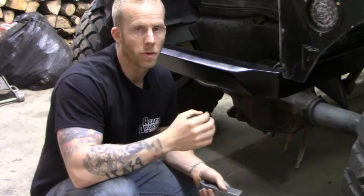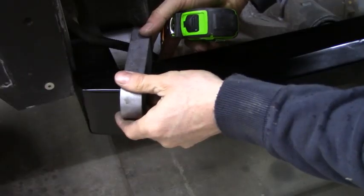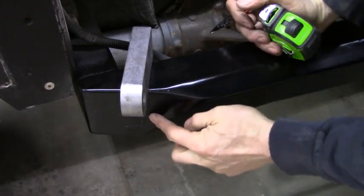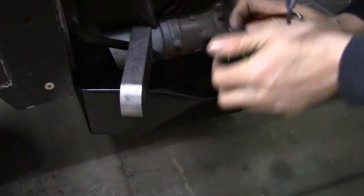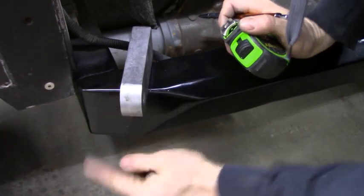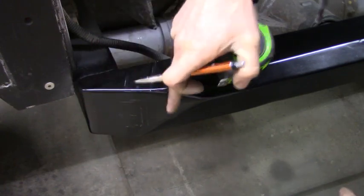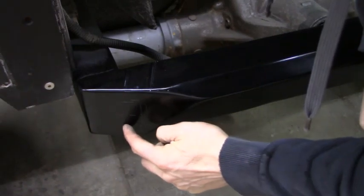Now, when you mark it on the bumper, it's very crucial you double-check your measurements from both sides so you know they're even with each other. The first thing I did is I measured from here to here, which is my entire flat surface, and I want this D-ring to be in the center. I laid the D-ring at the angle I wanted up here to make sure I'm straight with this flat surface. Then I measured from the bottom to the top and got the center, took the D-ring and traced it out on the metal. Then I went to the other side and did the same, taking measurements from the sides and top and bottom to make sure it's in the same spot. Now all we have to do is cut this rectangle out.